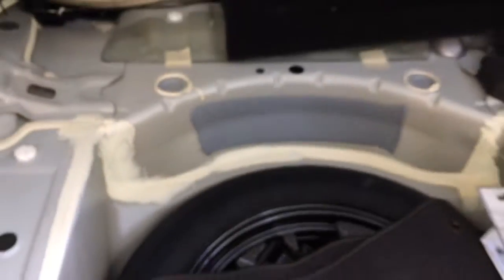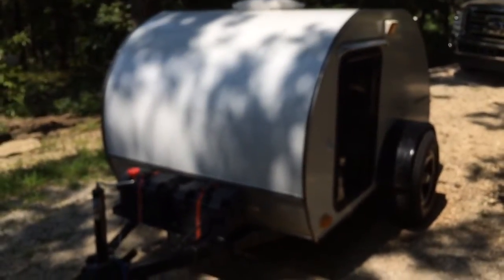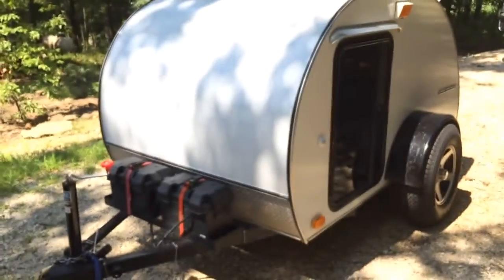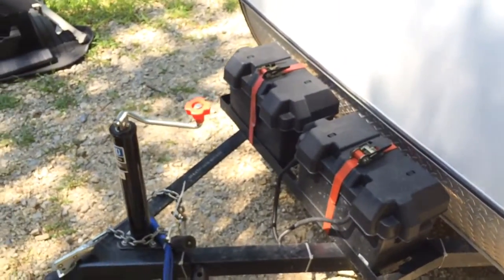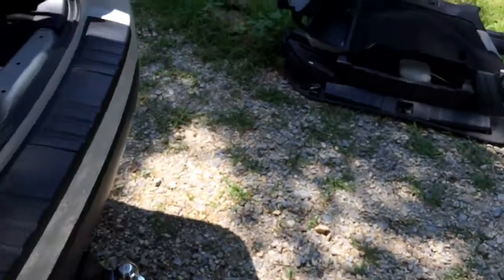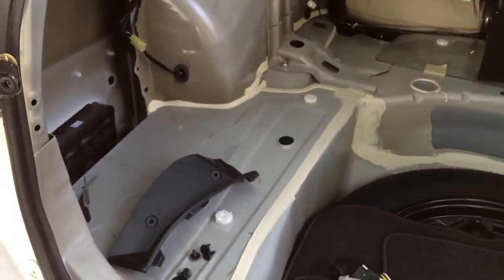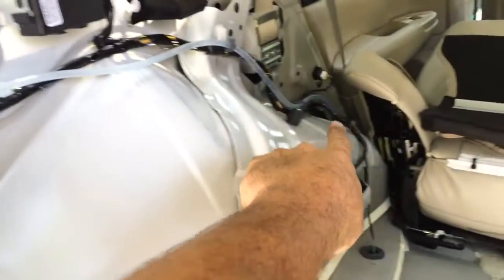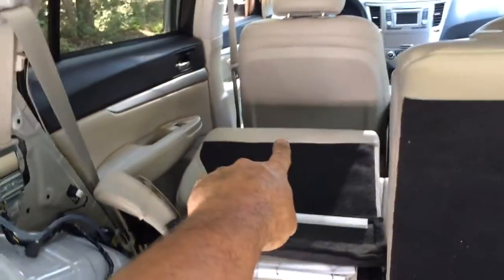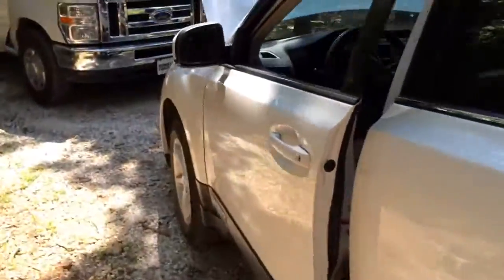Today we've got to replace this four-way plug with a seven-way plug because the trailer being pulled is a little single-axle camper-type trailer. It doesn't have brakes or anything like that — it's very light and the Subaru can handle it. But it does have onboard batteries that we want to keep charged using the 12-volt auxiliary line, so I do have to run a power wire to the front of the vehicle. But instead of running it outside, we're going to follow the factory harness along the thresholds, up under the dash, and through the firewall to the battery.